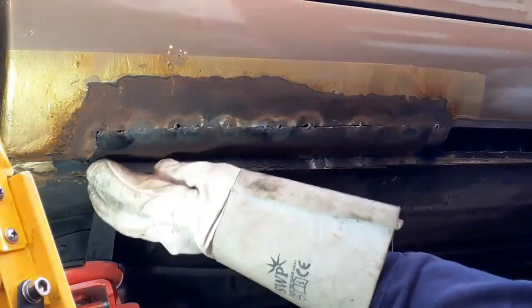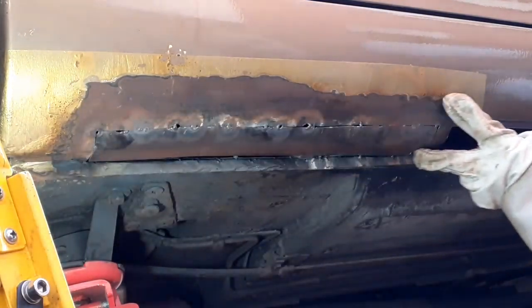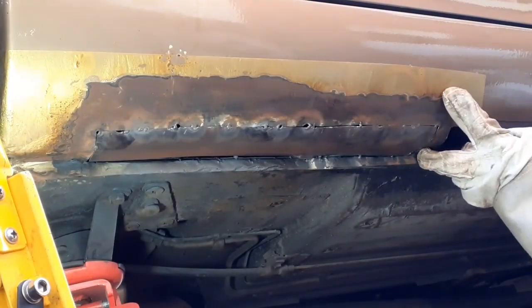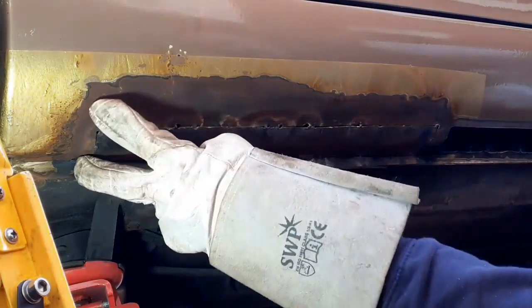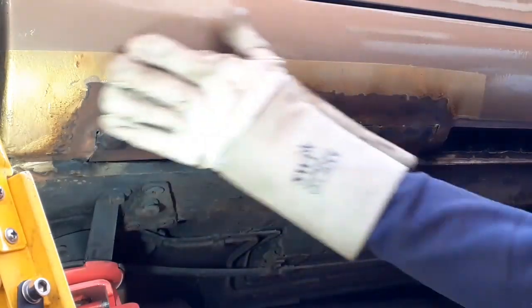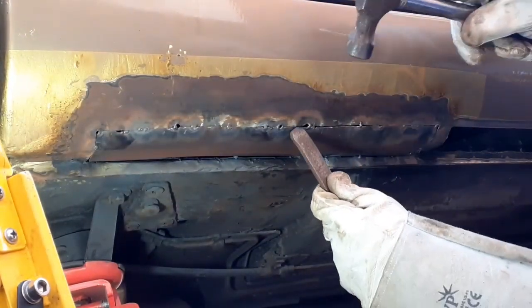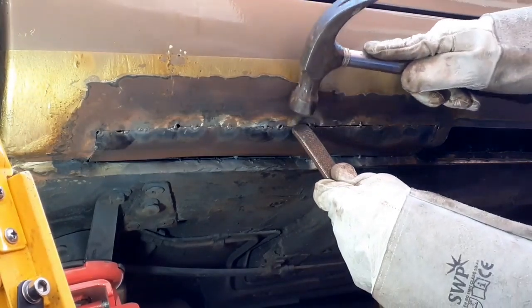When this has been filed, I'll probably put a fine sliver of body filler and body lead. I don't really fancy using filler — I'll use lead in this area to fill all the slight indentations, and I'll file it with a large dreadnought file. It'll all be metal. There won't be any modern white filler in there, I don't think.